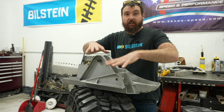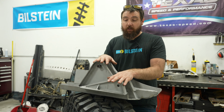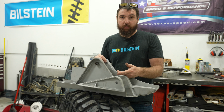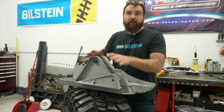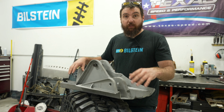All right, so this battleship looking apparatus here is the link mount assembly. So this is, you know, the passenger side has both the upper and lower being a three link. These are both tied together and I made sure everything keyed together nicely. And this is one of the things I welded together while we were still doing phase one. So everything should fit up in the body.